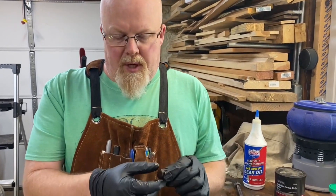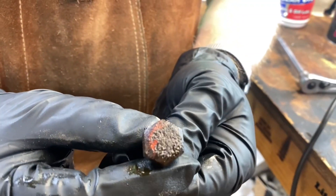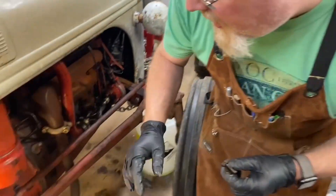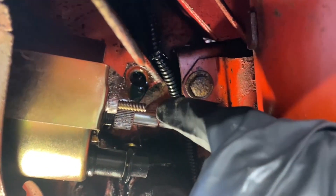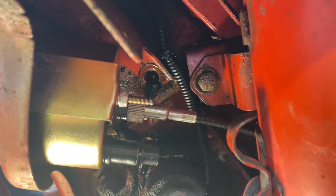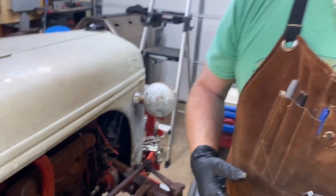Now with converting it to putting grease in versus 80-90 gear oil, we have to place a spot for the oil to come in. I pulled this bolt out of the steering gearbox — there are pictures online if you Google it. This is the bolt you pull out from the gearbox, and right now I have oil draining out above the proof meter. You can see that hole is where the oil is draining out, so we're getting it all out before we put the grease in.